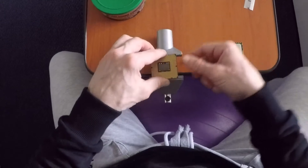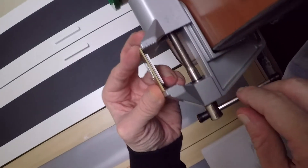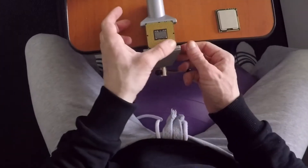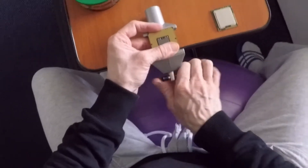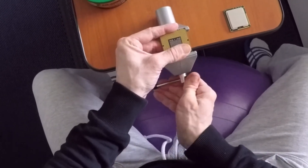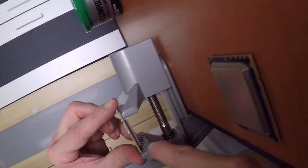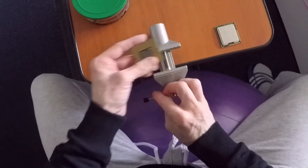As I showed in the video, the right side of the CPU goes to the moving part of the vice, and the left side goes to the fixed part. Try to align the fixed part as high as possible, right on the edge. As you start to rotate the vice, the metal heat spreader will move towards the fixed part of the vice head. When you rotate and force the cap off, you'll feel exactly the point when it gets really hard — that's when the metal part has reached the fixed part of the vice head. Don't push beyond that.